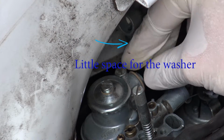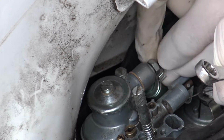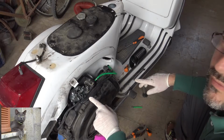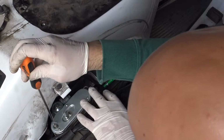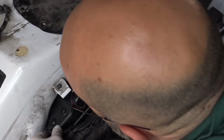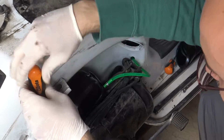Now that the carburetor is well fixed, you must reconnect the fuel connection hose. This must be done with the gasket on both sides of the fuel connection hose. Reposition the air filter. Just align the minimum adjusting screw and then put in the two bolts that hold the air filter, and you finish. Put the cover. This is held just by 2 screws.